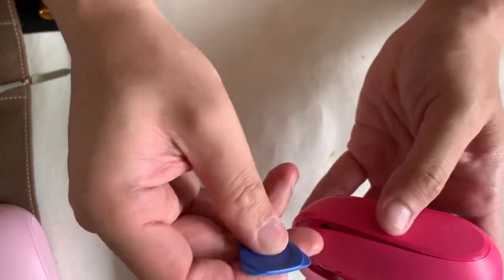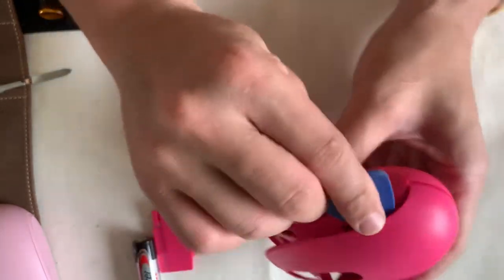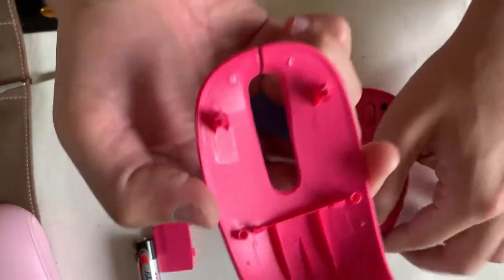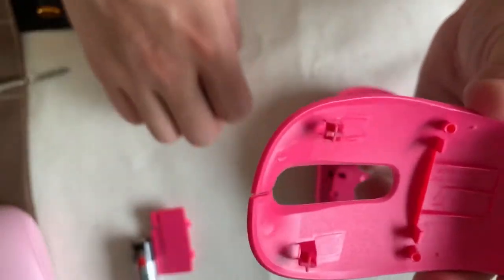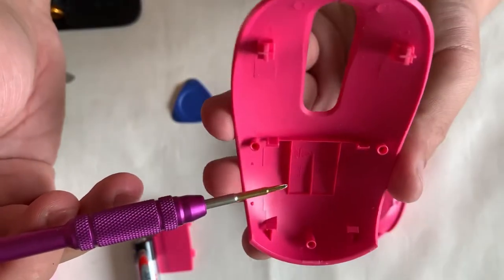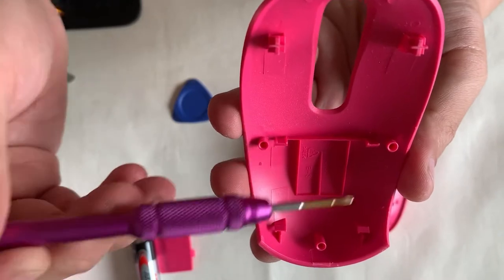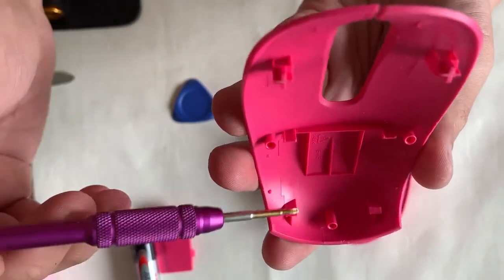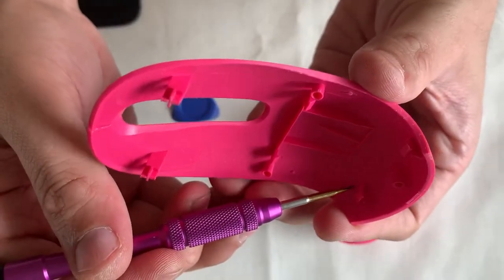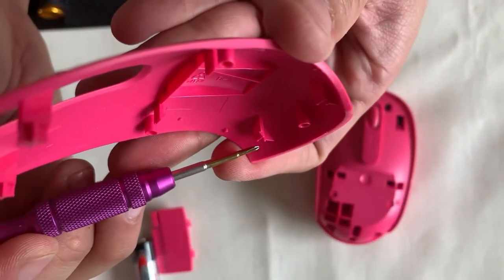Let's move on to the dismantle. On the left and right click, you need to pry it out a bit, then use a plastic tool to shift and slowly pry on both sides to remove the top shell. It's held up by four clips, so first-timers please be very careful — these plastic clips are very small and tend to break or get bent. If bent, you can slowly push it back and add a bit of super glue to strengthen the weakened joint.